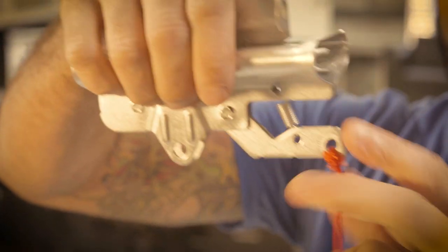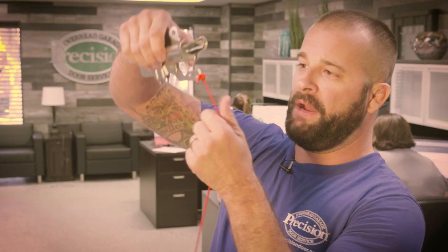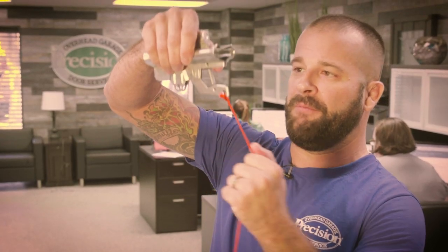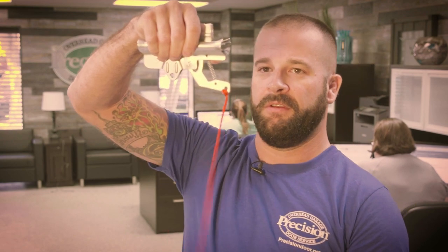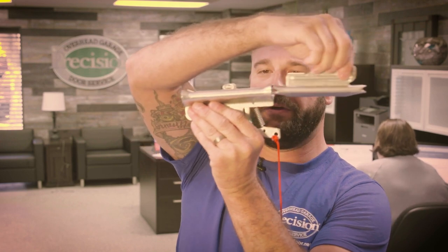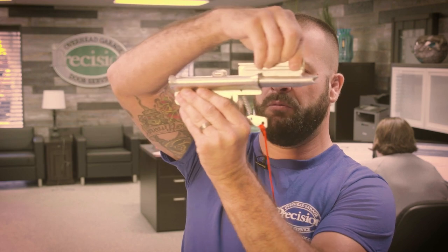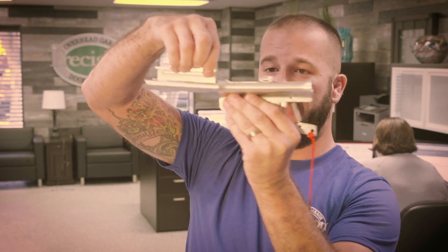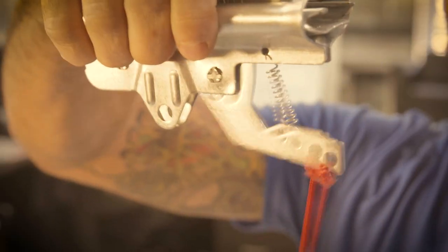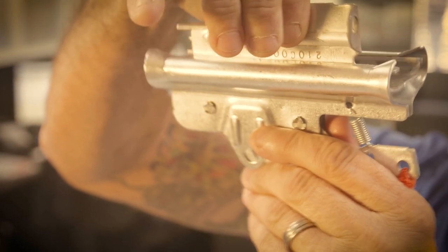The third is a LiftMaster product. This is very common with anything made by LiftMaster, Chamberlain, Craftsman, and all those major names. If you pull down on the red cord you'll notice that a lever drops. If you pull it down and pull backwards, that's locked open — this piece can move freely through. This part is hooked to the operator; this part is hooked to your door. They're going to pass through each other and not be engaged until it's locked back in. To lock it back in, simply pull down and pull towards the door.